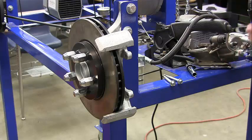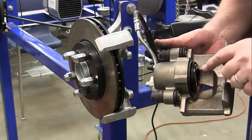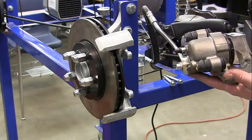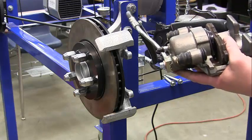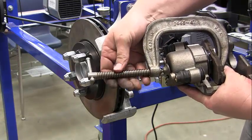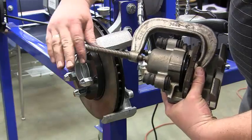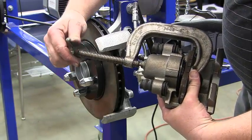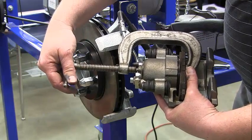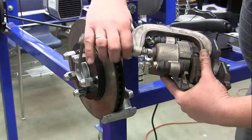If these were old pads, our piston here would be sticking out slightly — you can see it's moved out a little bit. We have to push this piston back in. The easiest way is to take your old pad, put that here, get a C-clamp, and put it between the back of the caliper and your pad. Turn it and that will push the piston back into the caliper. Do it slowly — it can damage the master cylinder if you really crank it in. Just a little bit of pressure is all it takes.